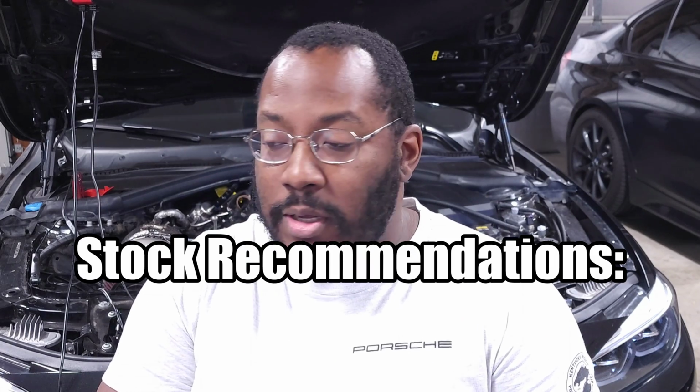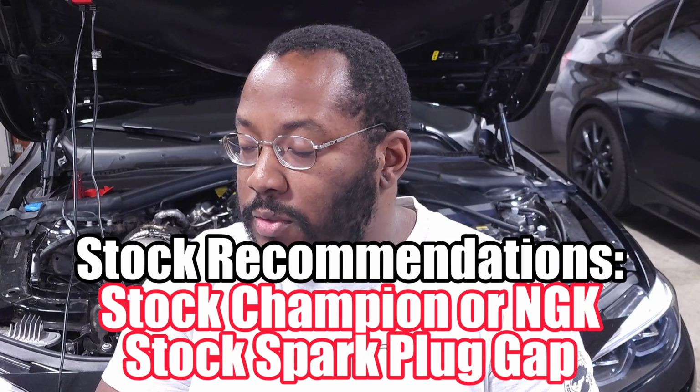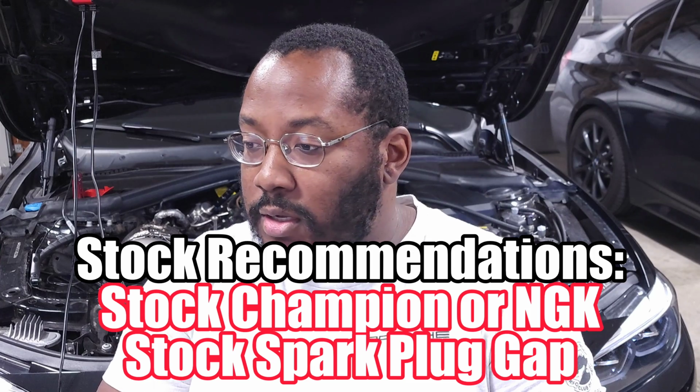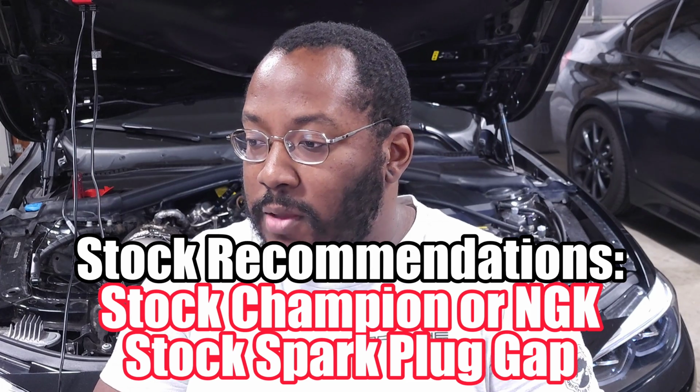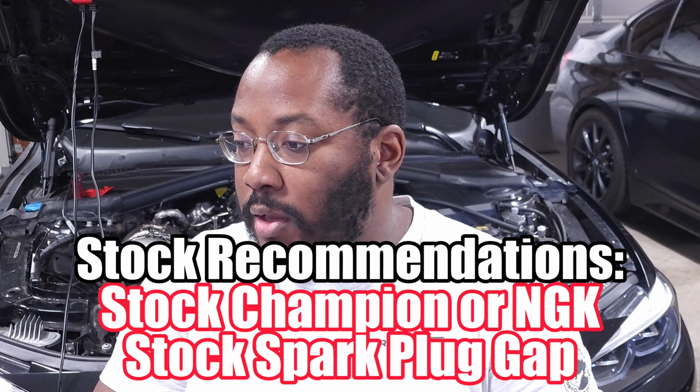So first of all, of course, on a stock car, I recommend OEM plugs. So that would be, on a Gen 1, the NGK 94201 or the Champion 9425. So if your car is stock and you're running pump gas, maybe even a couple basic bolt-ons without a tune, then you should just stick with the OEM plugs.